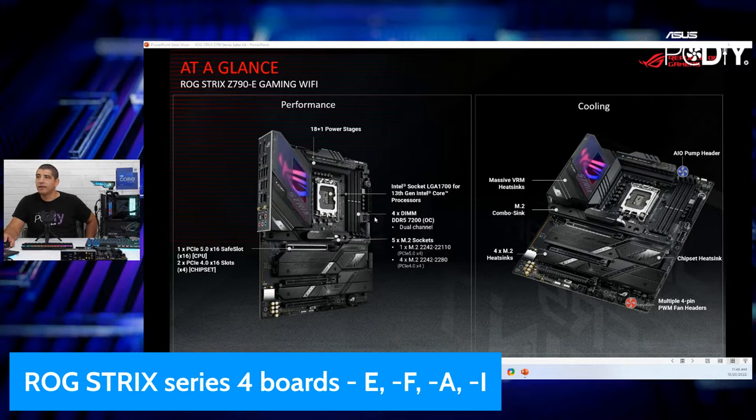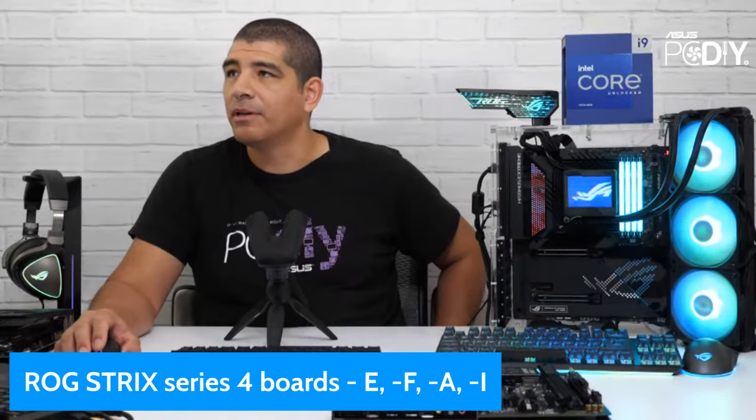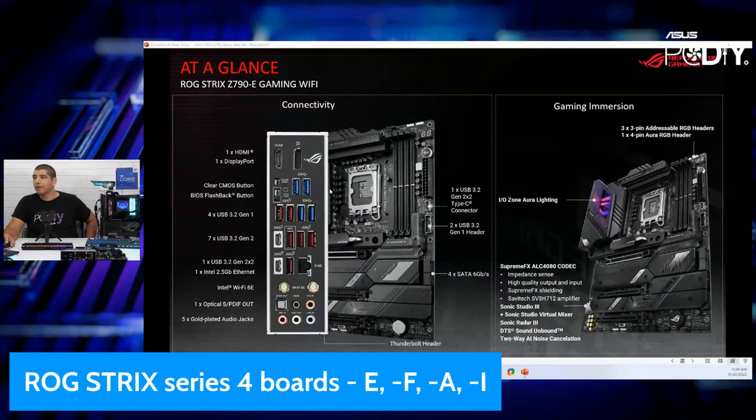And I'll take a little bit of a flyover in terms of just some of the physical connectors that'll be on the motherboard, right? When we take a look here at the rear IO, we're going to see we have 2, 4, 6, 10, 12 ports. So very similar to the Maximus line right there. A little bit of difference in terms of the rated specification support, right? So on the Maximus series, you could see 40 gigabits USB 4, Thunderbolt, but here you can see you have 20 gigabits is the max, you have 10 gigabits, and then you also have 5 gigabits connectors.